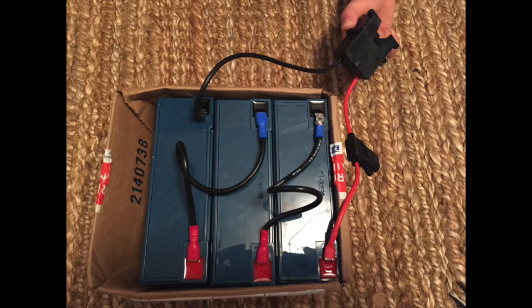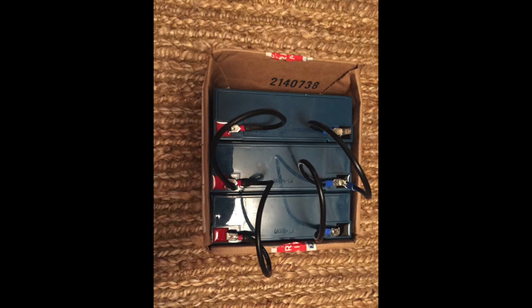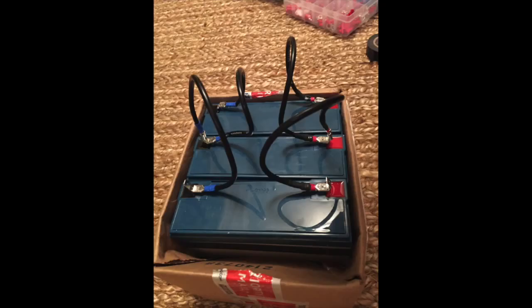At this point, you can go ahead and put it into your power wheel. In order to charge the battery, it's going to have to be connected in parallel — all three batteries have to have their negatives connected to negatives and their positives connected to positives. I use specifically a 6-volt battery tender charger. I usually get them charged in about three hours. It works like a charm.